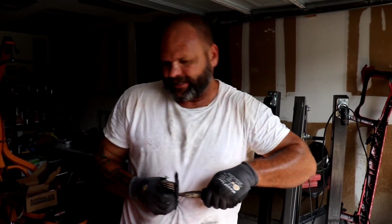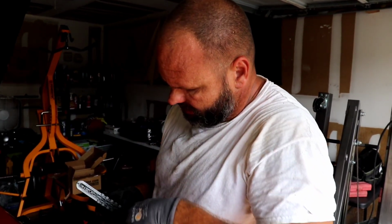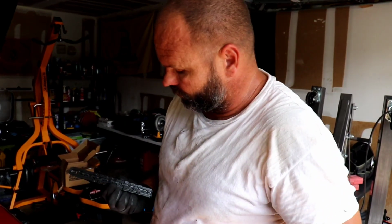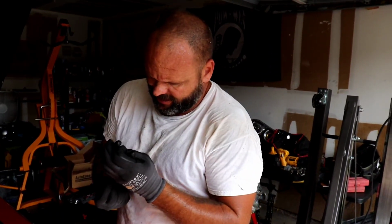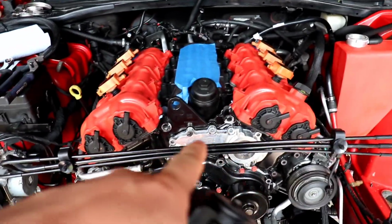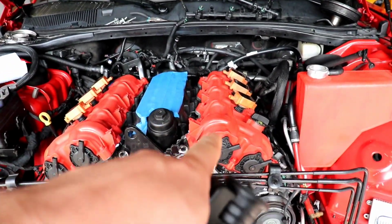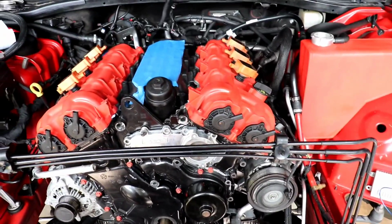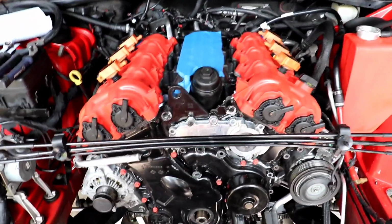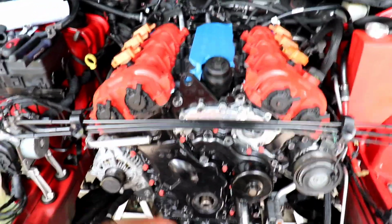With the timing chain, the way it is set up is extremely difficult to get. I'm probably maybe two links off, and it's just gonna happen sometimes. You can't cry over spilt milk. But the difference right there, and we talked about this last week, that 1 to 2 throws off the VVT in here. So you have a dual overhead cam. One controls intake, one controls exhaust. But as you go lower in the RPM range, to be able to control the actual VVT and get better gas mileage, it actually slows down the cam duration in order to make it more fuel efficient.